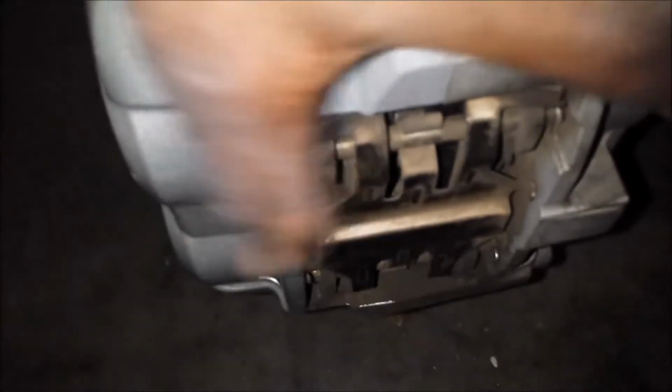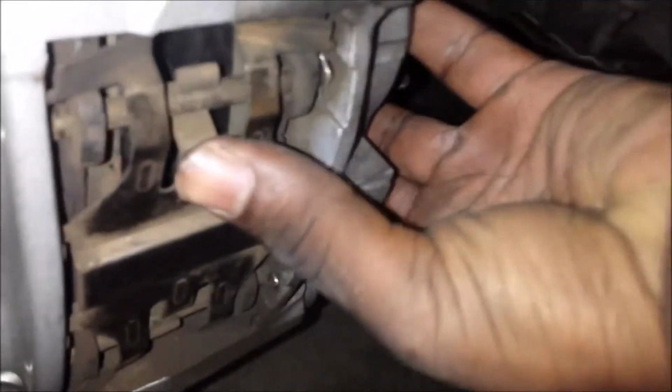This is some of the simplest brake pads you could ever have to replace. Really simple. I mean, they're usually all simple, but you just slide this thing out, and you've got a cotter pin over there. Instead of smacking it, I just use a screwdriver on that side, get it turning. Of course, remember to press down over here to get the pin to move out easier. Anyway, so that's it, man.